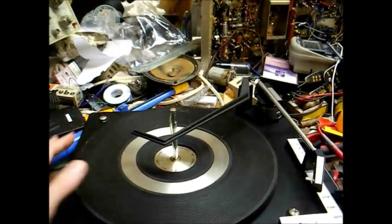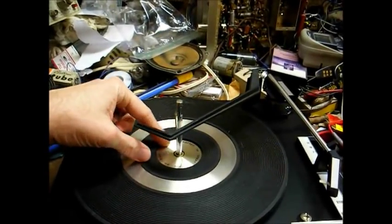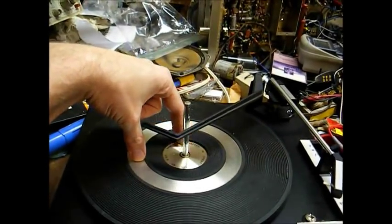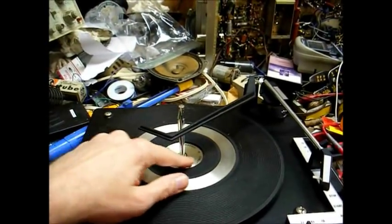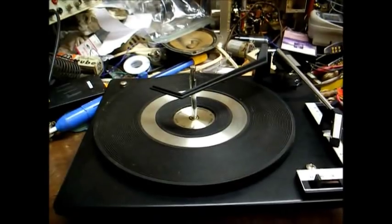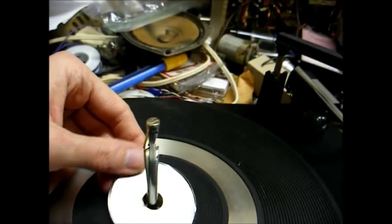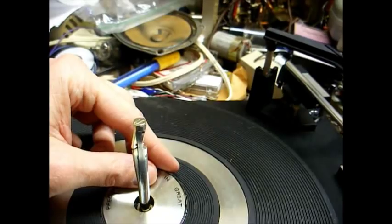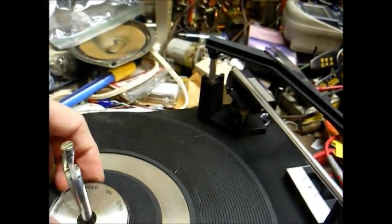The first thing we want to do is remove the little clip that holds the turntable platter in place. In this case, you have to gently pry up this little decorative ring here to give you access to the clip. You want to be careful when doing that — you don't want to crinkle up the little decorative ring. You want to keep it nice and straight. All you do to remove it is just take a small blade screwdriver or similar tool and gently pry up around the edges, and it'll easily pop out.